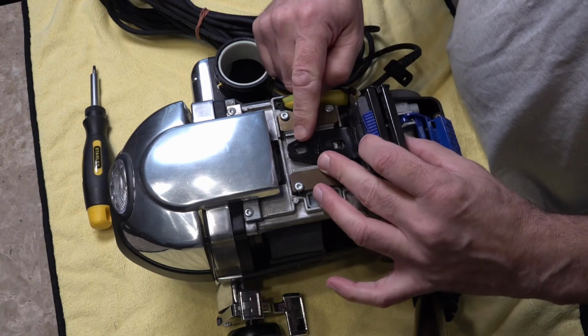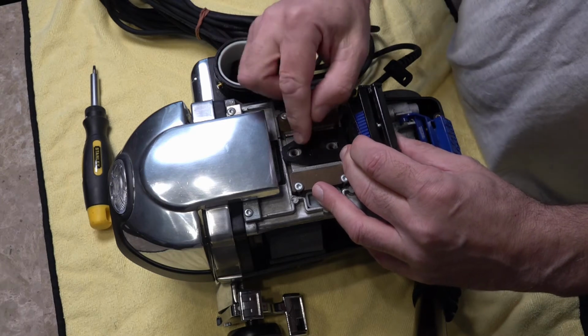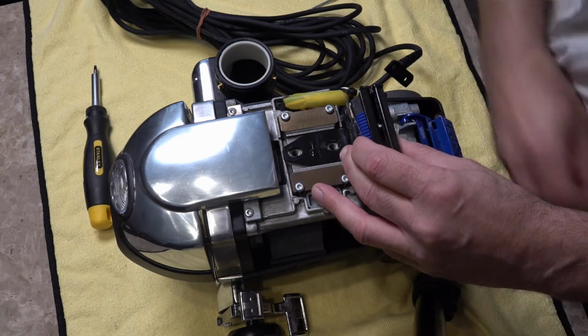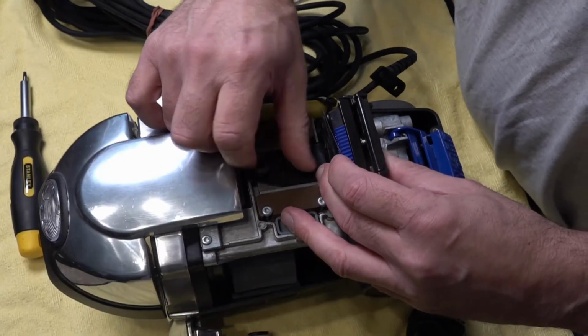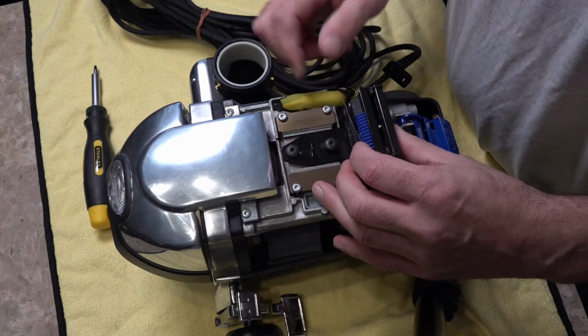Lift that up, and then what you do is tilt this back, and you can see roughly where the screws have been. If you've got a new one, then the screw heads want to sit central, so this wants to be central to that. So we just grab our Torx 20s, so just loosely tighten them. So we can still adjust it because we've kept those nice and loose. So don't have to go all the way.